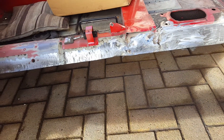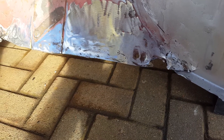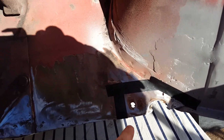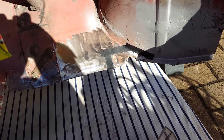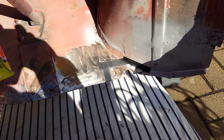So what I'm going to look at right now is this area down here. I'm going to get it marked up, cut a template, and then get a nice new piece of metal in there. You can see the bit taped off — I'm going to cut along here, along here, down here, make up a template and put the new bit in. I'm going to use my air cutting disc — it's a smaller bit, which means it's easier to get into these angles. It hasn't got as much power as the bigger one but it gives more accuracy and a cleaner cut.